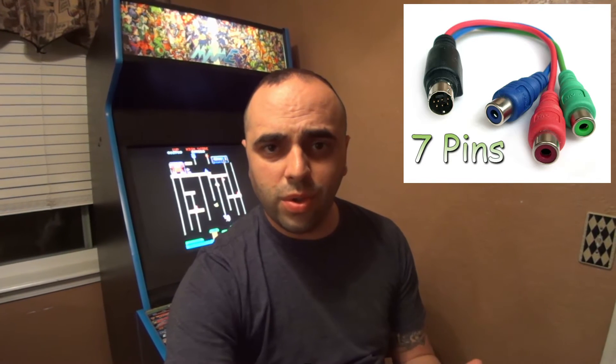What you're going to need to do is hopefully have an old computer laying around, order the video card and the cable, and set it all up. When you get it all set up, the thing I had to do was put Splashtop on it, because it's going to try to output in progressive scan, and this is 480i. With Splashtop I was able to go in and set the settings to 480i, and then it smoothed out the picture as you see behind me.